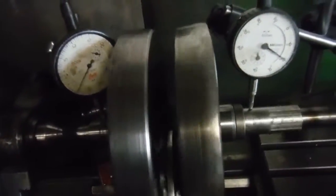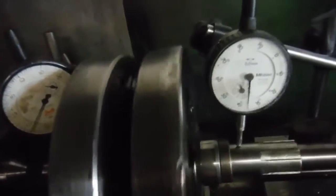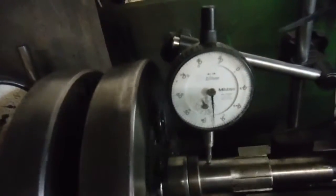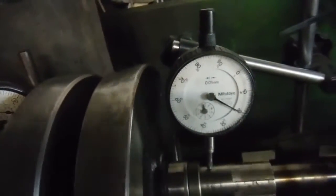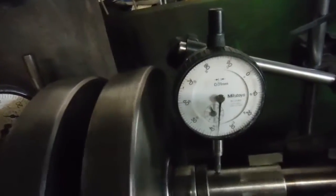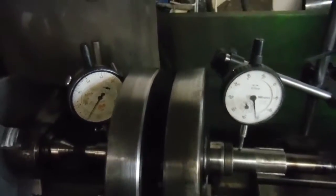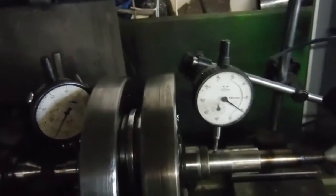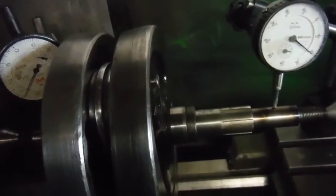The edge of one flywheel is like an old threepenny bit from bashing with a hammer of some sort. But if we look at this dial gauge — from one number to the next is 0.1 of a millimeter, or four thou — we've got eight thou run out there right by the main bearing. Moving the gauge along closer to the end of the main shaft and giving it a spin there.